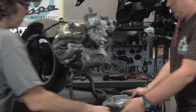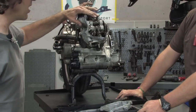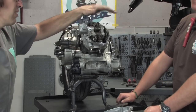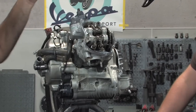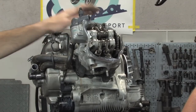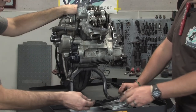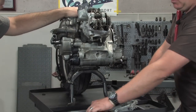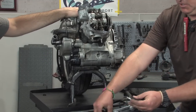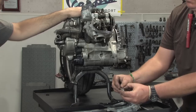You can see Steve got the valve cover off. You can see the valve train. They call this engine a four valve engine, so there's two intake valves and two exhaust valves. If you look at some of my tune-up videos, I talk about how to adjust the valves, but when we put this motor back together, I'll adjust the valves again. You obviously need to set the valve clearance. And here's the molded valve cover gasket that really should be replaced every time you go into the motor, and the five specialty rubber packings that go on these specialty fasteners that hold the valve cover on. So you can see this thing goes like so, right? Yep, like that with the new ones once we put it back together.